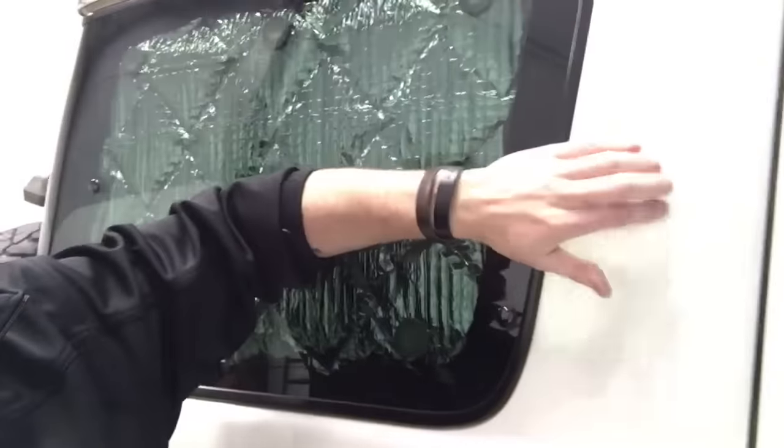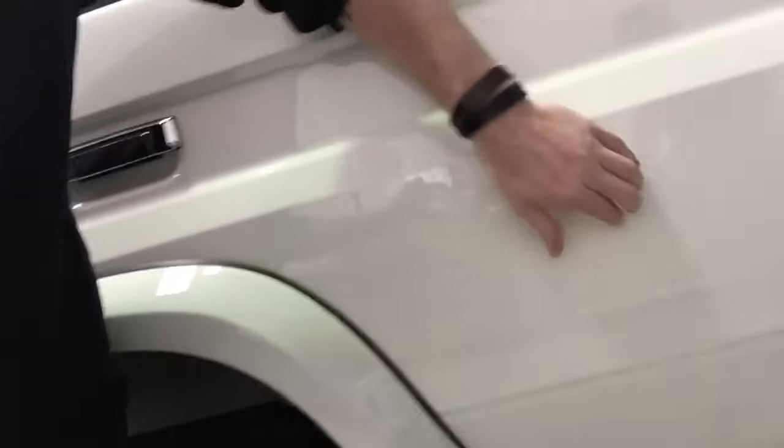So what we did — we said yeah, we can help you with this. We can actually put some deadener on the inside. When you look at the factory panelling, it's really, really thin. So when you actually deaden it, it becomes a nice solid piece. It puts layers between the outside of the car and the inside — simple science. The reason we start with the four doors is because they're the four largest panels going to the interior cabin where you're actually sitting.